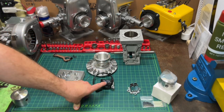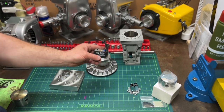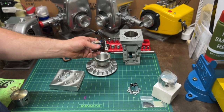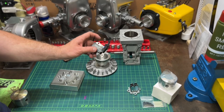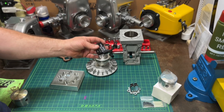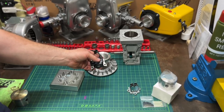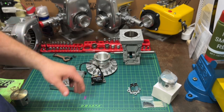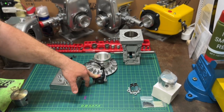Here's one of the big differences regarding ignition: these are analog transistor coils, so it's just like your vintage coil — your Wico coil — but minus the points. Instead, this little rectangular nub right here is an electronic chip built in to replace your points. John Wall just installed one on his engine and said he's never seen a spark like that — he couldn't get it with his points.